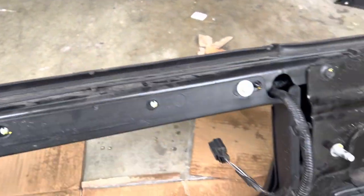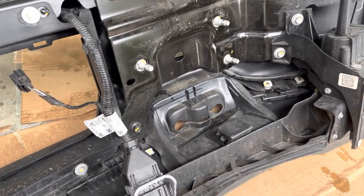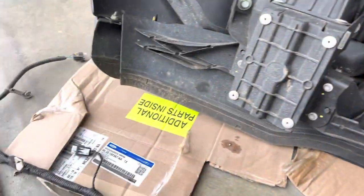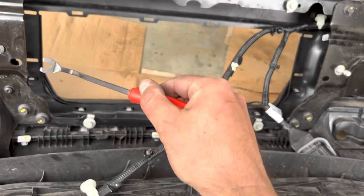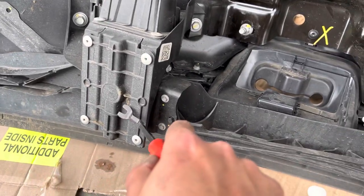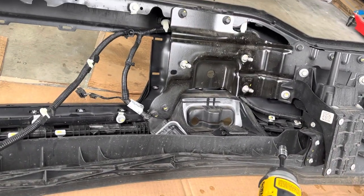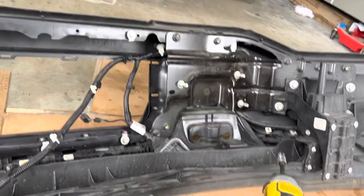Unfortunately it looks like we're going to have to disassemble this quite a bit. Here's the wiring harness — it just goes all over. There are some 10mm bolts here and probably some 13s. We're going to start zipping some stuff off, trying to remember where it all goes, and get this wire replaced. This is going to take a little while. I got the old one about halfway out — this side's all out. This trim removal tool is going to be your best friend because a few of these are in tight places. You've also got to unplug from the sensors and unhook the aero front splitter on each side. Just go slowly around and keep going.